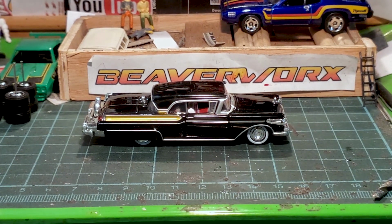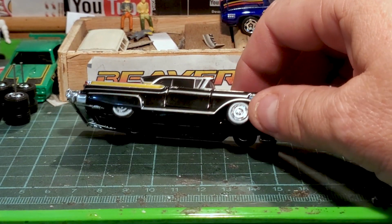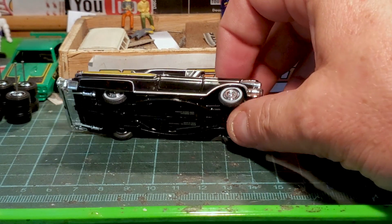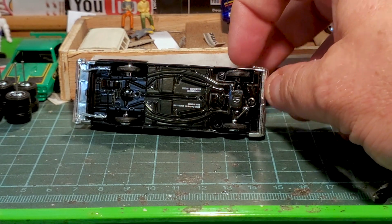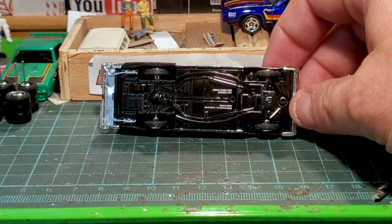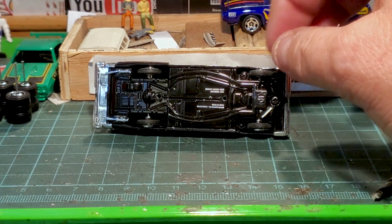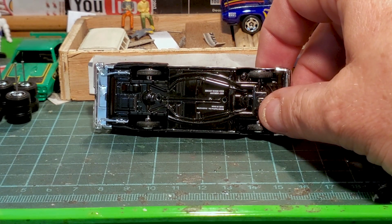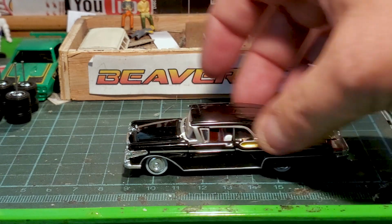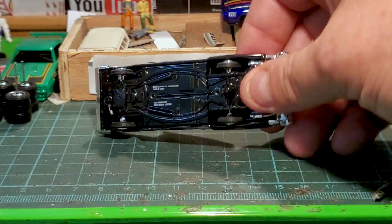I've done M2s before, and it takes a little bit of work, but they're actually pretty easy to do. You don't have to drill them. They've already got a screw. You just take the screw out, drop the chassis out, but these wells are going to have to get opened up, so there's some Dremel work, and this is an all steel base, so we've got to do some drilling and some digging, and then I'll polish the inside of the wheel wells as well. But we're going to try our best not to do anything to the outside of it, or any of the plastic bumpers or anything else like that, because this thing is just too awesome.